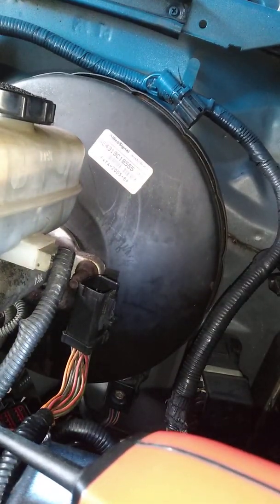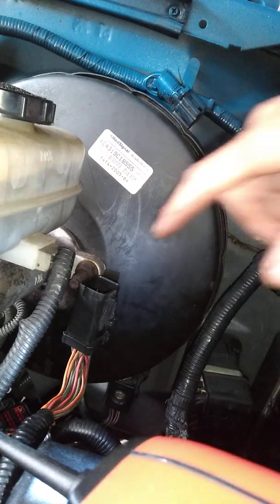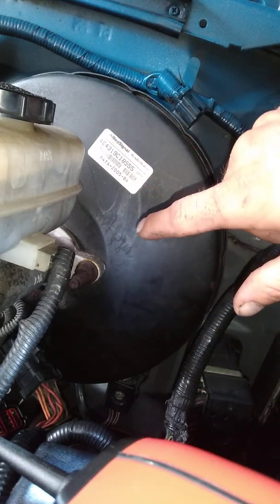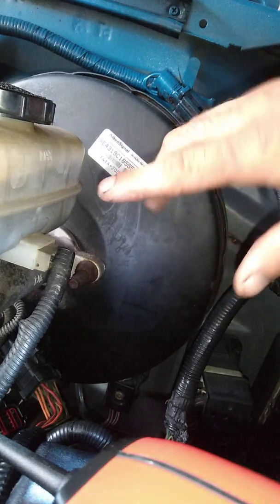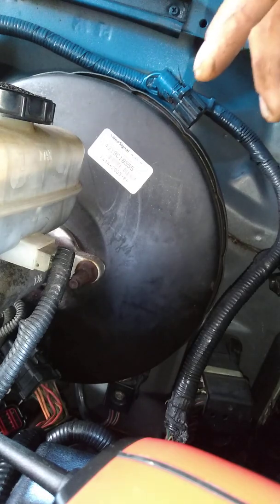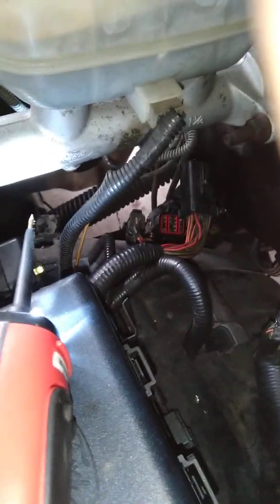As you can see, every pin on the shorter wire has continuity on the positive and negative side. And then when I connected it on the other end of the six-foot wire that connects to the transmission, it had only one pin that had voltage, and there was no ground current. So that's how I ended up finding the bad connector and wire.